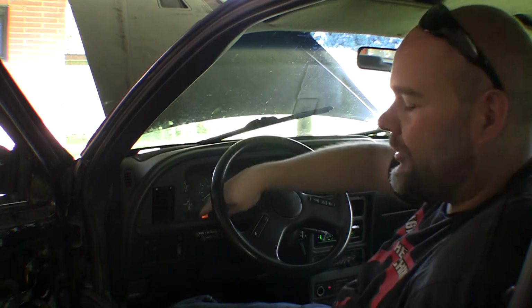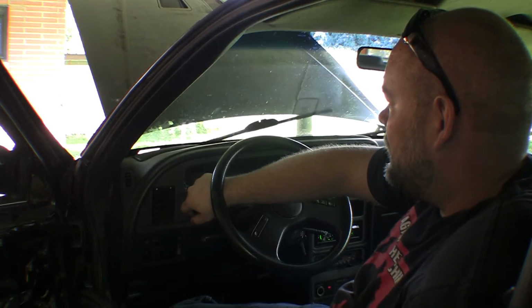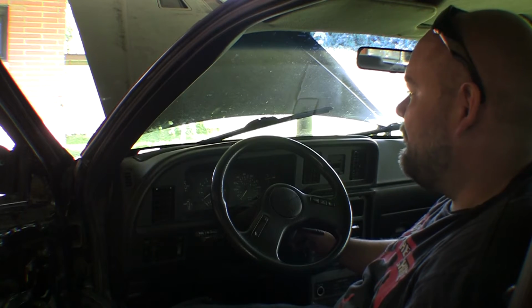And if I turn the stock off, it does not want to return down. That's low, turn it off. There, it gets stuck. It does this almost every single time. I have to sit there and fiddle with it, or just let it go and park it and shut the key off, and the buzzing will stop. But I think if we dig into the actual wiper motor, we'll see the contacts and we can just clean them, and then we can fix this issue.